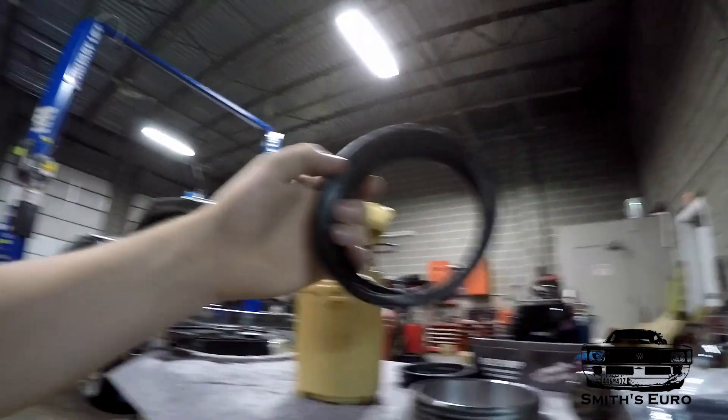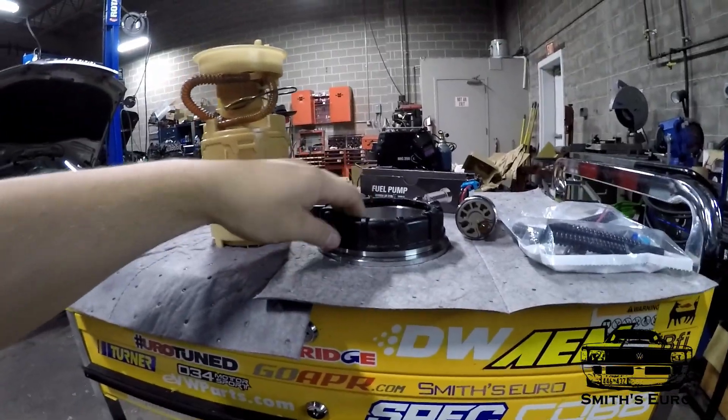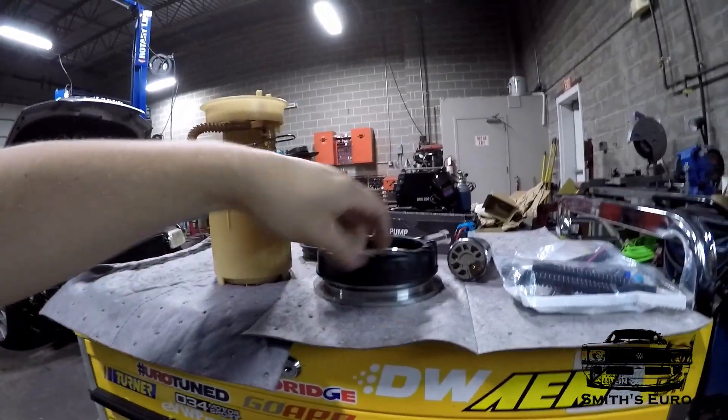What this does is it gives you a flange to weld into any fuel tank — aluminum or steel — and it adapts Mark 4, Mark 5, Mark 6, whatever style that has this kind of screw-on cap. The fuel pump will sit in there. I'm going to mark this out on my fuel tank and cut it, then weld this to my fuel tank. It's a brand new tank, never had fuel in it, so there's no safety issue.